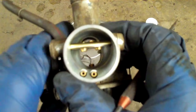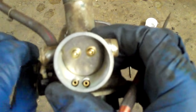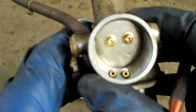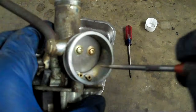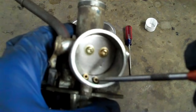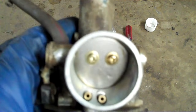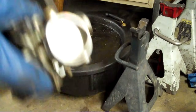When we put this choke on — there's half choke, no choke, completely choked. So we're choking the carburetor off completely. Now when it's all blocked off, where's the air going to travel? It'll get through the crack a little bit right there — this is a design flaw — but it'll also go through here and here. So you have these little air jets.